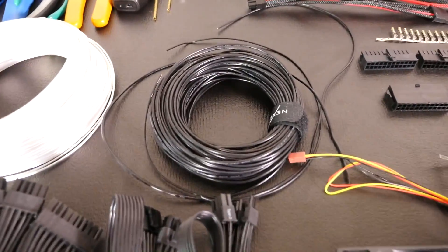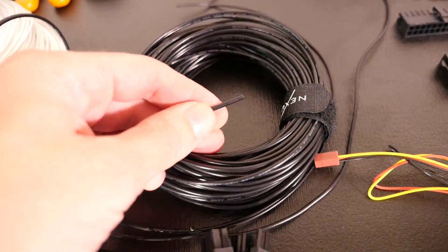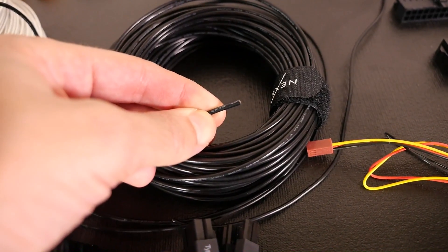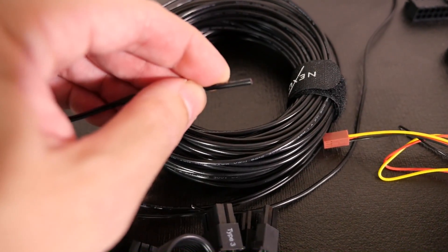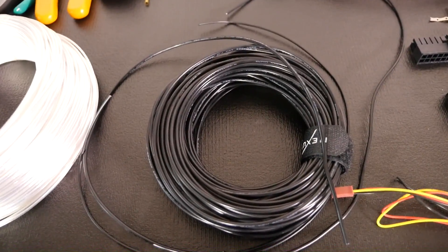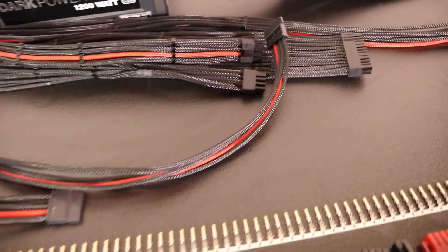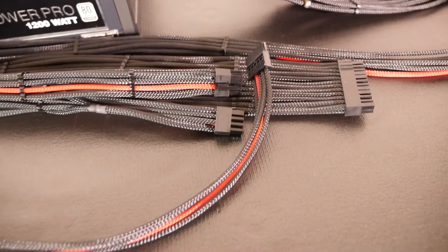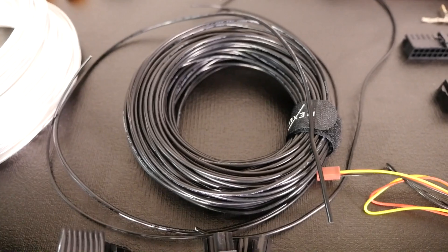This is not really going to make much of a difference, but it does — I find I can get much better crimps with the bigger sized wire. The pins have more to dig into, it just works better, you get better contact. So you have a stronger crimp with better contact, which is going to be a lot higher quality and more reliable. I also like the aesthetics of 16 gauge wire — the slightly bigger diameter in the sleeving makes it look a little more chunky. It also trains better, so it's a great little upgrade and I highly recommend it.